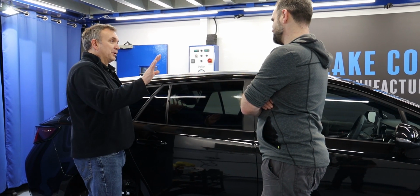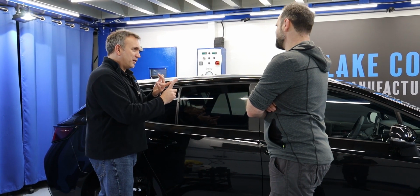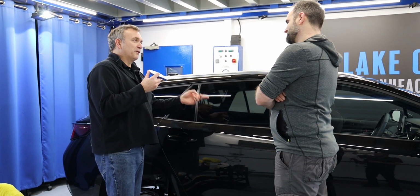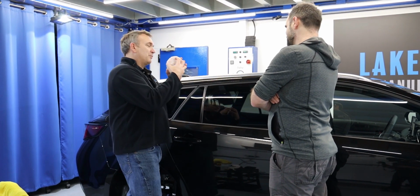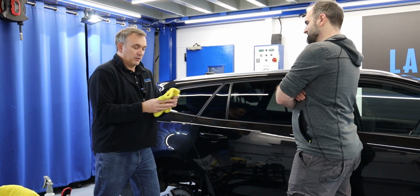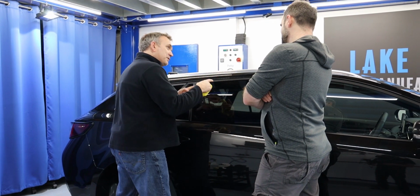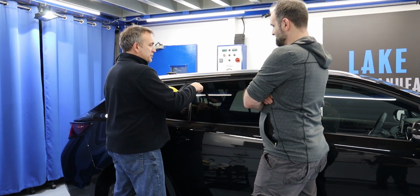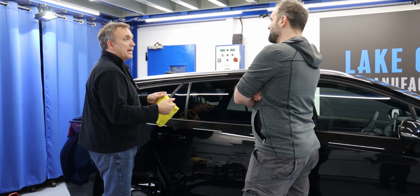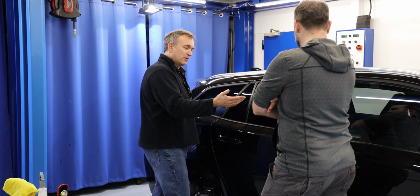I always machine polish, but it doesn't literally remove scratches. I'm using a machine polisher, microfiber pad. We talked about why the microfiber pad seems to work very well on the paint, when we said it grabs the compound, so it's not flinging it everywhere. If you think about it the other way, if you were to put compound on that cloth and push hard for a long time, you'd get the same cleaning effect. Why wouldn't you do as much of the window as possible with a machine and microfiber pad, and then switch to the corners with your fingertip or a smaller machine?